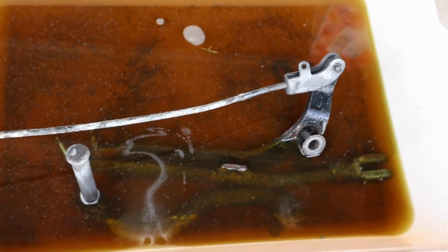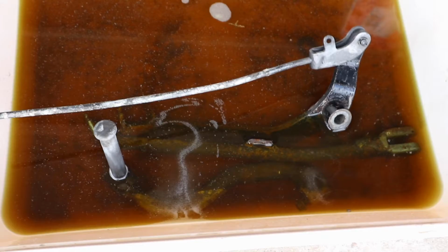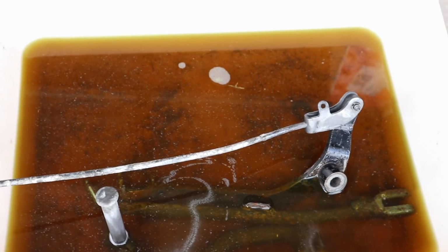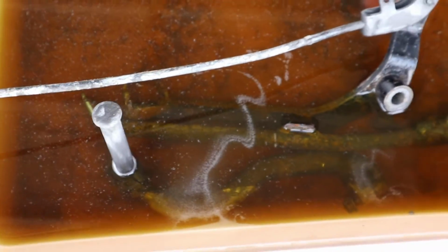And then what's left, I should be able to just easily sand off or scrape off or use the Scotch-Brite or whatever, but at least it's loosening up the rust that doesn't just fall off. So, CLR works. Make sure you use gloves. Ooh, I tell you, my hands were burning a little bit when I didn't, but the stuff works.